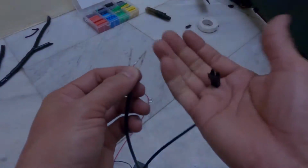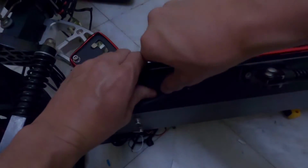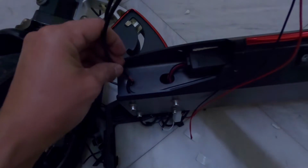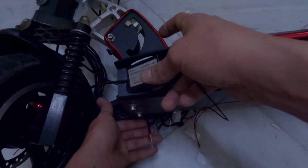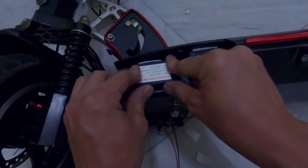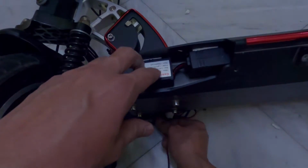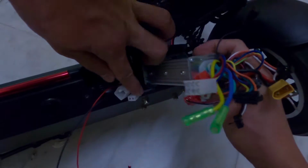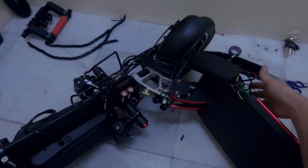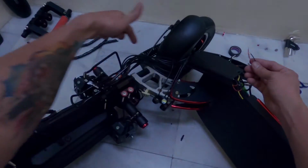After removing the connector, I proceeded to the installation of the LED controller. I put back the anti-theft alarm using the double-sided tape and stick the LED controller as well. Make sure to align the instruments properly and carefully run the wires through the holes. Ensure the LED controller is securely set in place. Next, I returned the electric scooter controller, making sure that the wires from the LED controller are exposed. Next thing I did, connecting the positive and negative wires of the LED controller to one of these wires that goes to the battery or power source.